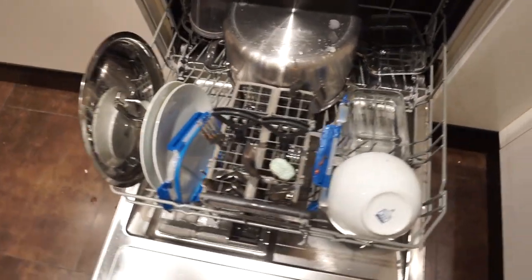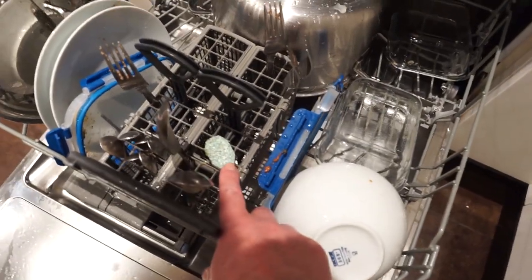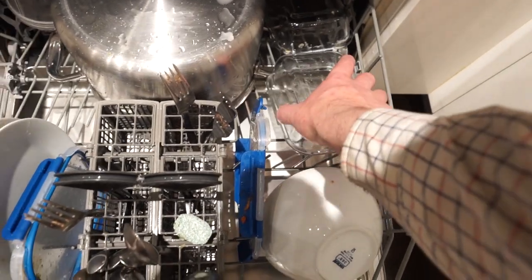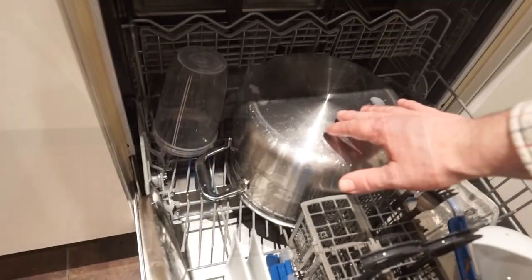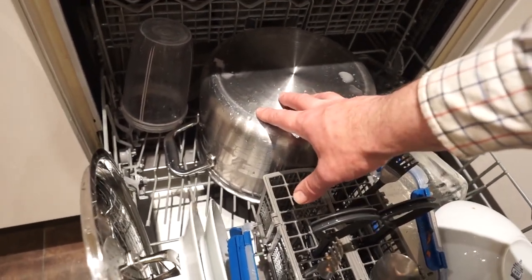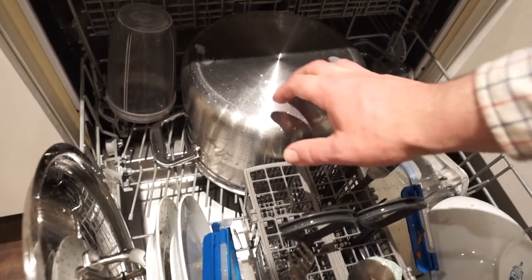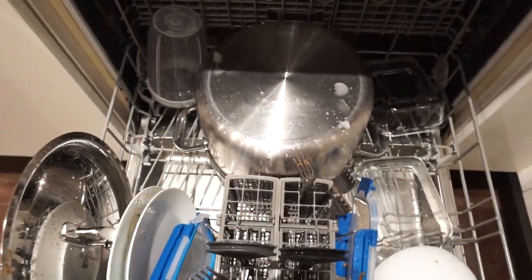This gives a quick idea of the issue I was having with my machine. After a normal wash the tablet would be undissolved on top of the tray. Also the dishes and cutlery wouldn't be particularly clean — it's almost like they've just been rinsed off — and they wouldn't be warm to the touch either. It's also worth mentioning that a large pan in the dishwasher can cause the spray blades not to be quite as effective when spinning to reach the top tray.